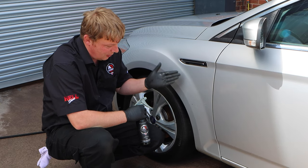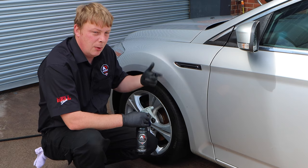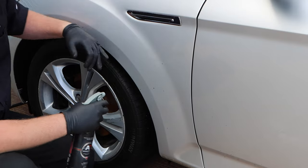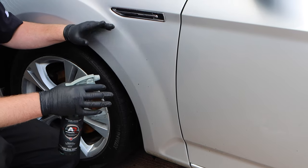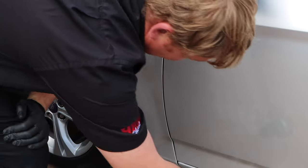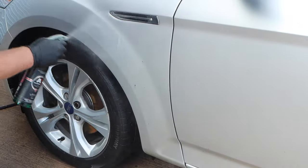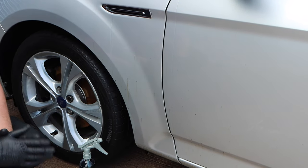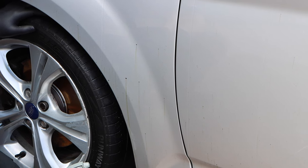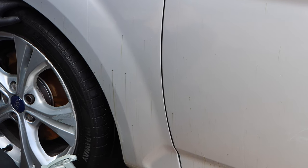We're on a silver car and we've got no issues spotting tar at all — I can see there's quite a lot there. The vehicle's already been washed, so it's gone through the pre-wash, snow foam, and two-bucket wash stages. We're going to tar and glue it and then do the purple rain on it afterwards as well. What you should see straight away is it start to run, react, and dissolve. It is a solvent so make sure you're working in a well-ventilated area. If it's a blustery day outside you might want to consider wearing eye protection as well. As you can see, there's no problem at all seeing where the tar is on this vehicle — it's got a lot of large spots.